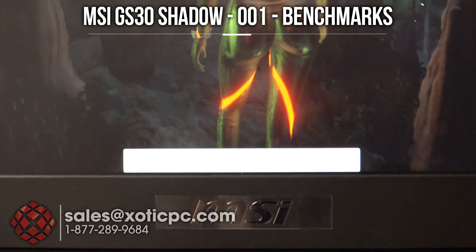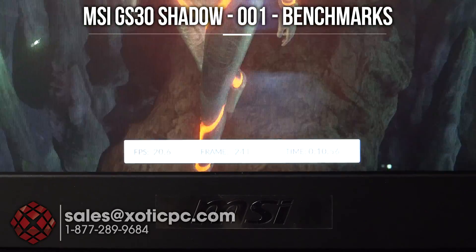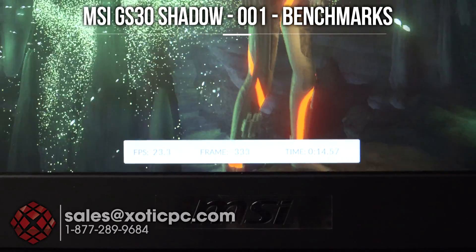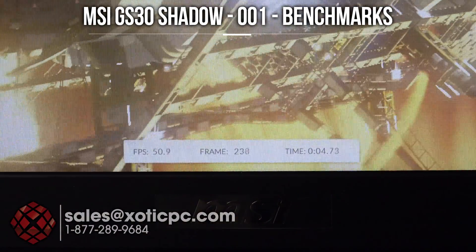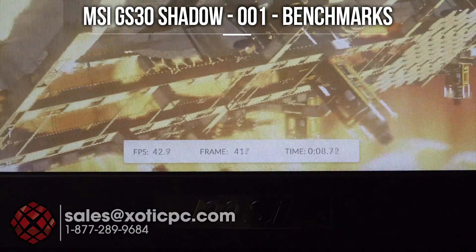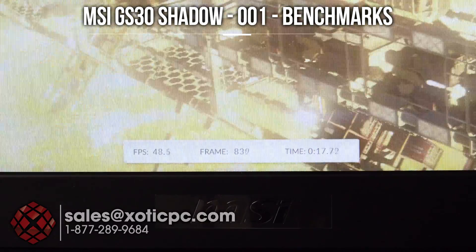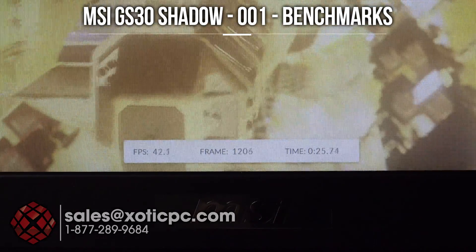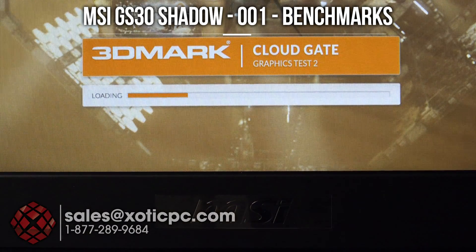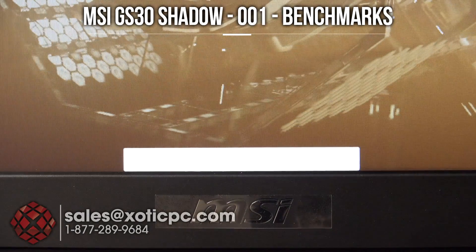Some of the more demanding ones you might have to knock down the graphics settings a little bit — you might not be able to do ultra or max — but it can still run pretty well. This one's hard to see but I'm showing about 20 to 24 frames per second there. Here's 3DMark Cloud Gate — another one where you can see frames per second. Very playable; most people consider anything over 30 frames per second as playable and it's handling this just fine, around 45 to 50 frames per second. This is a benchmark program made to really tax the GPU, with several different tests targeting different GPU levels, so the main purpose here is to show you that you definitely can game on this computer.